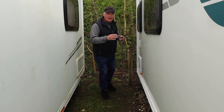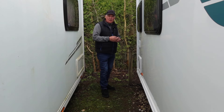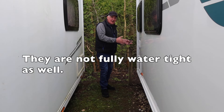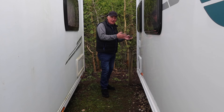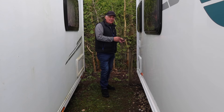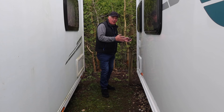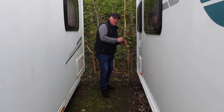On social media I spotted a thread where people new to caravanning were asking if it's okay to travel with the cistern full of water. From a safety point of view, the answer is no — you should never leave the system full; always drain it down. A full cistern holds between 17 and 18 litres, and a litre equates to a kilo, so that's up to 18 kilos of weight at the rear of the caravan. That will affect handling and make it very unsafe to tow. My top tip: always drain down your cistern and empty your cassette before you set off home.